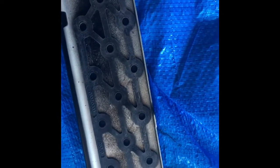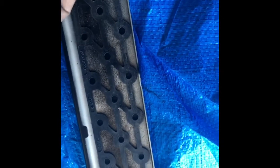Wasn't that bad. Probably the most time-consuming part of it all, though. Probably helps when you do put it in, don't just try to push them in flat, because then it's harder. If you put a quarter in and then push down, it goes in a lot easier. And then you're able to just daisy chain it along and just do them real quickly. So don't try to push them in flat, you know, the whole circle in at one time.